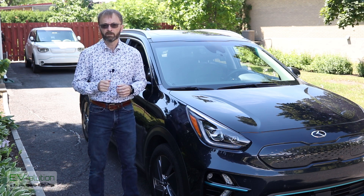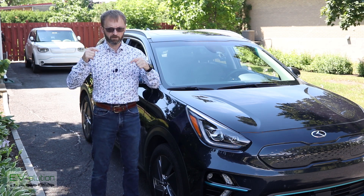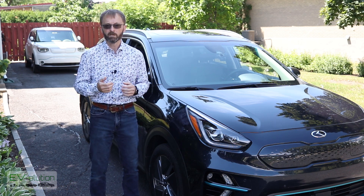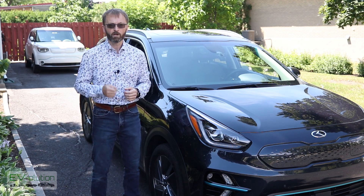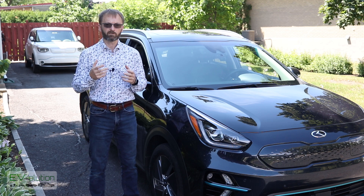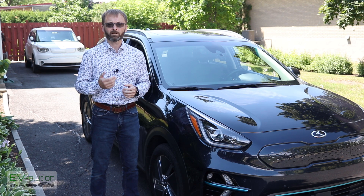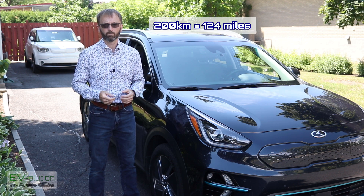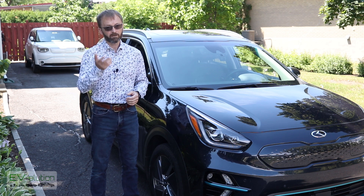There are a couple of little things to note. You can put any tire on your electric car, but there have been reports — I'll put links in the description — showing that choosing a sportier tire can increase rolling resistance and reduce the range of your electric car quite substantially. I believe it was Motor Trend that did an article on an e-Golf where they replaced the tires with sticky rubber and upsized wheels, and it affected range negatively by 25%. That's a huge hit on a car with 200 kilometers of range, but if you want sportier handling and you're willing to sacrifice range, you can do it.